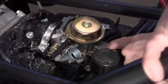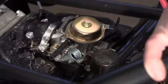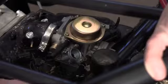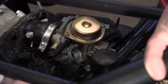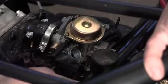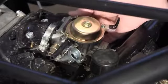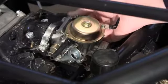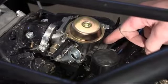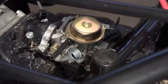Now I want to mention a couple of things because we don't have the other systems such as the gas tank and the air filter hooked up to our engine yet. Whenever we do, remember to connect everything you need to to the carburetor. For example, whenever we hook up the fuel tank, this is the hose that's going to connect to the fuel tank and also runs into the carburetor. Whenever we hook up our gas pedal and throttle cable, remember to hook it up on this side. Whenever we hook up our air filter, this is where the air filter is going to go. These extra hoses are for something called the PCV system, and I'll talk about that later.